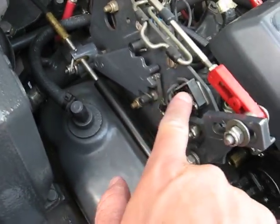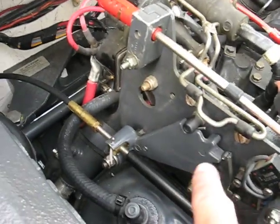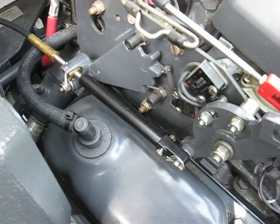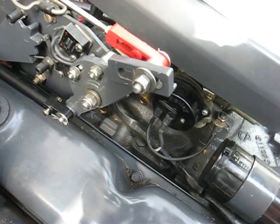But the other thing is the overstroke switch, which I wanted to talk about. This is the interrupter; this is the overstroke. When my boat is in forward gear — I may have to go down to spin the prop, so bear with me. I could not get the cam to re-center. Technically, this really needs to re-center, which it is now, but it just won't. When it's in forward gear, the engine is stumbling and running rough. I'm glad that I did not cut anything, because I adjusted my overstroke switch — when that cam in forward gear pushes that switch in, it cancels out your interrupter. This centering is no big deal because it doesn't matter. I would recommend doing a sea trial with the boat before you cut any wires to bypass the ESA that they talk about.